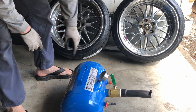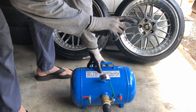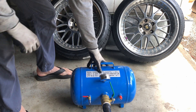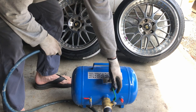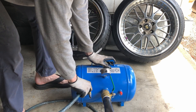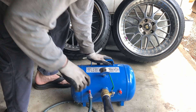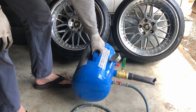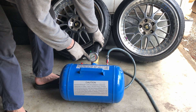I didn't need it fitting the others up luckily, but this one's a bit bigger — it's actually a 245/40 profile tire on an 11 and a half inch wide rim, so it's a bit of a stretch. To use it, make sure the one valve is closed, the other valve needs to be open, then you plug your air hose straight in and just wait for the gauge to fill up.